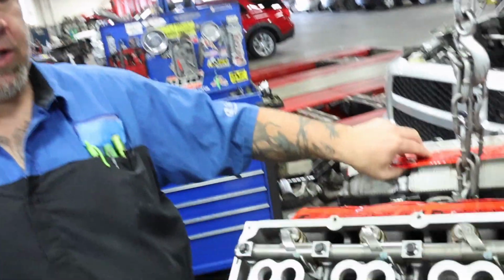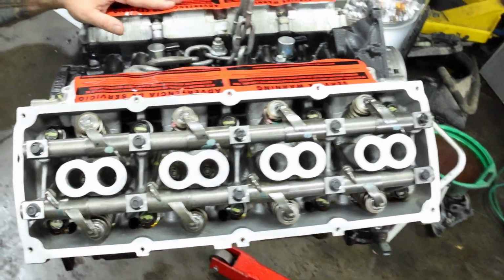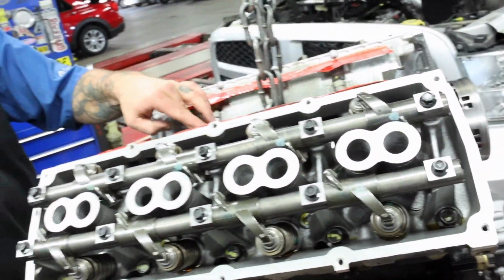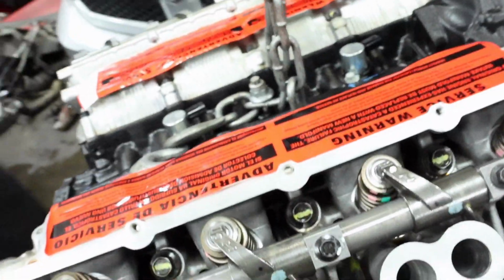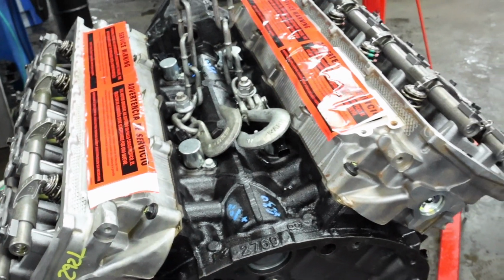I have put in engines from different remanufacturing companies, and we've had problems with them. We've had problems with the MDS solenoids because they can't get manufacturer MDS solenoids. The last one that I did, I've had to go through and replace all 4 of those, put manufacturer specification MDS solenoids back in.